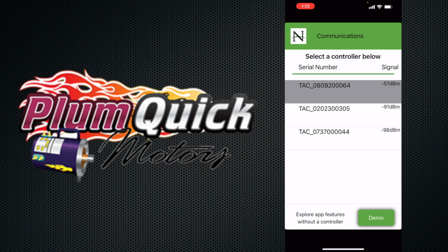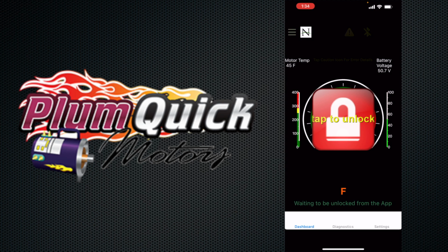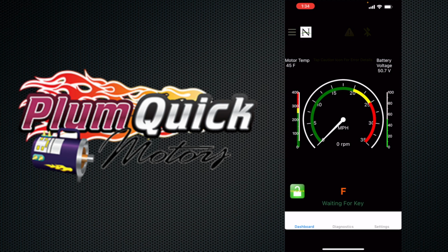The first screen you're going to come to is the dashboard. You have your motor temp, your battery voltage. You have this little green lock down here. It's unlocked. If you hit the green lock, it'll say tap to unlock. You can leave the key in the ignition just like this and go somewhere, and no one can take this golf cart by turning the key on or off because the controller is locked. So this is a security feature here. To unlock it, you just tap it. Once it shows the little green key down there, you're good to go.